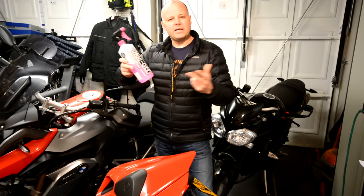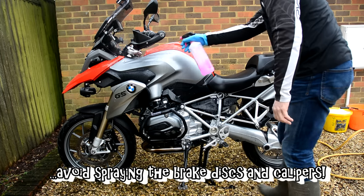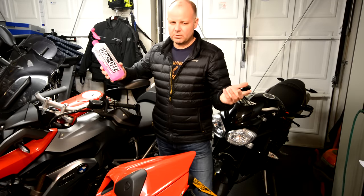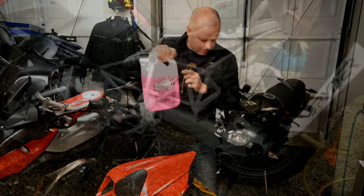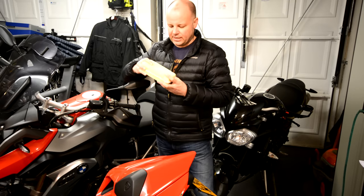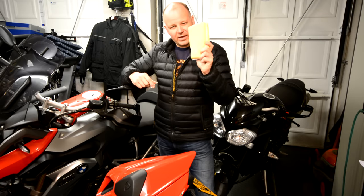The reason Muck Off can be controversial is because it contains quite a lot of salt, and salt is something you probably don't want to be adding to your bike. However, if you're very good about rinsing the bike off afterwards — and I'm a bit anal about that — then I'm pretty sure you get all the salt off. I find the good it does outweighs any potential danger. Spray it all over the bike, leave it for a good 30 seconds to a minute to do its thing, and then agitate it. It is quite expensive, so I buy it in bulk in big tubs mail order, which brings the price right down. Agitate and rinse it off with a hose pipe or watering can, using one of these — I call it a bug shifter — which is basically a sponge in a string net that gives extra friction without damaging the surface. Any stubborn bits, just give a little rub; don't go too mad as you don't want to damage the paintwork. That's stage one of my cleaning regime.